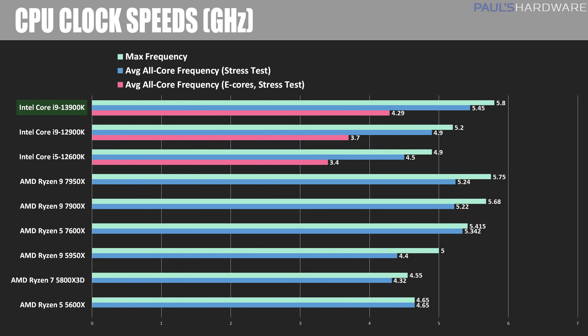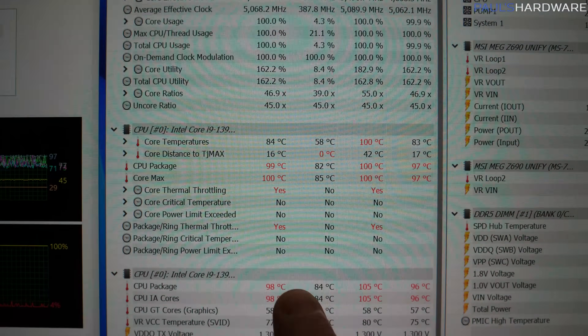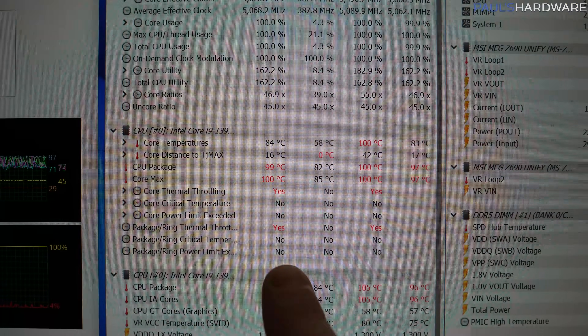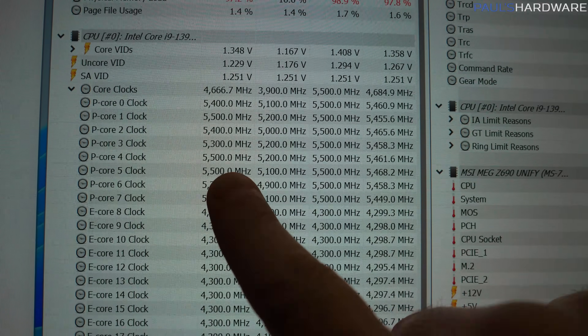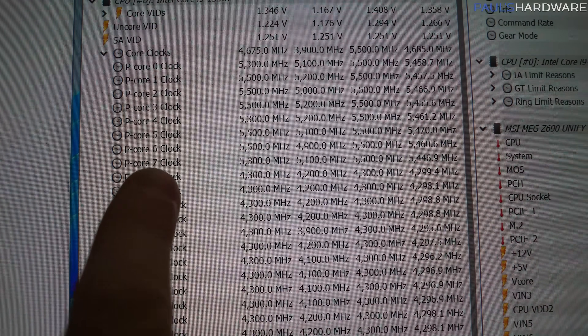And now let's go over system performance. Here are the actual clock speeds each CPU was running at — I'm showing the peak frequency each CPU hit across all tests, as well as the sustained all-core frequency during a 10 minute AIDA64 stress test. Even though we can see the 13900K hitting its peak turbo speed of 5.8GHz, the stress test resulted in temperatures as high as 100 degrees Celsius, at which point the 13900K throttles to stay within its operational range. The throttling typically dials back frequency by 2 to 5%, peaking at 20% in the stress test, resulting in an all-core average of 5.45GHz — not 5.5 as advertised — and the E-cores are at 4.29 instead of 4.3.